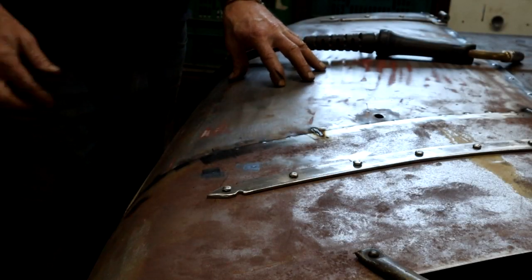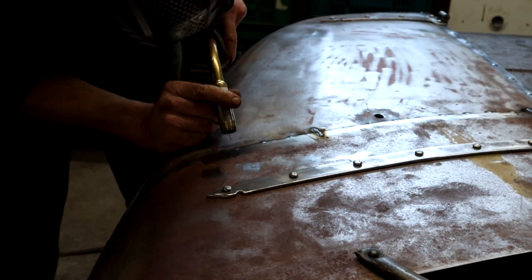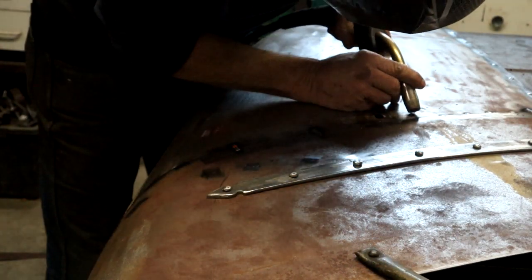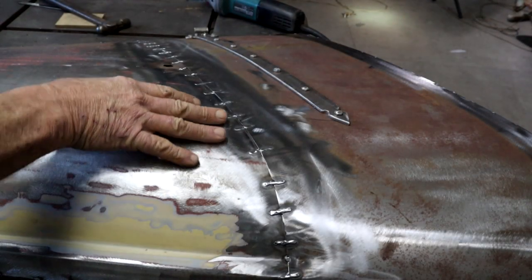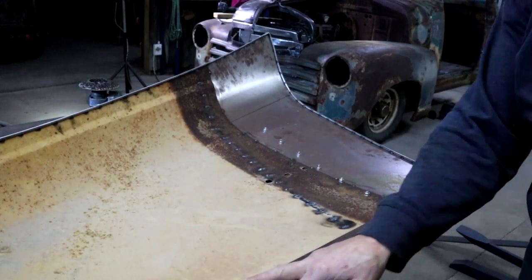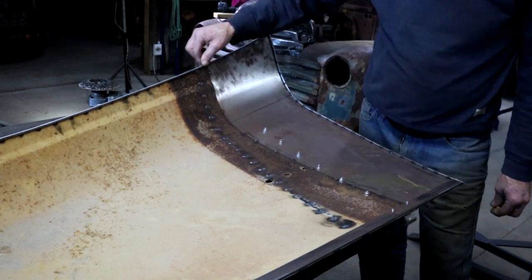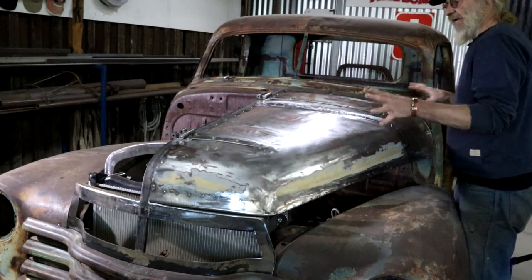The last thing I want to do to this bonnet while it's still on the bench are the stitches. Look at that — my sewing is done. So all my edges are done on this side, which is the hinge side. I've got flat bar plug welded from that side, and down here I've got my quarter inch round bar all the way along. That's braced and stiffened these edges very nicely. I'm finally done with this thing.